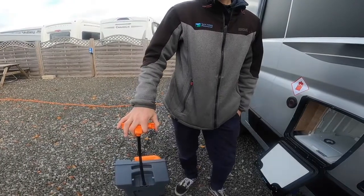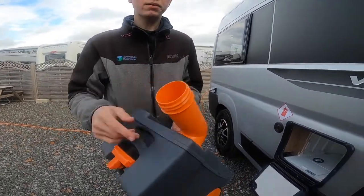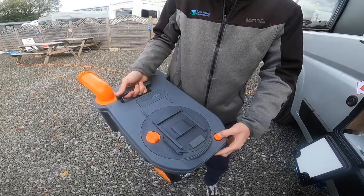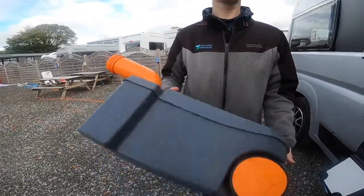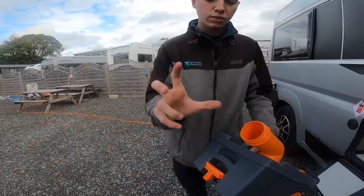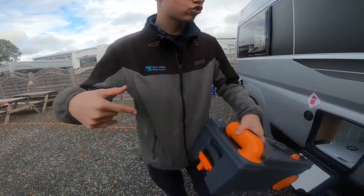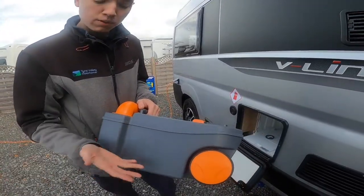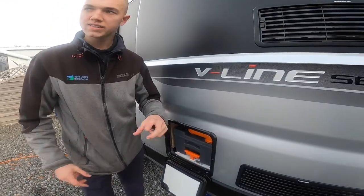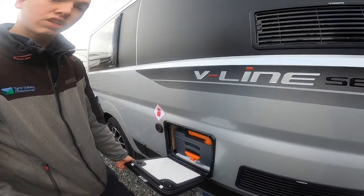You've got a handle to drag it to the waste disposal point, which is normally behind or beside your toilet block. Remove the cap, press the button which allows a bit of air in for consistent flow and stops it glugging, then tip it out. There's normally a tap there — put some water in and give it a final rinse. Using the grey cap, it takes 120ml of liquid — either the blue or green — one cap into there and it's good to go back into the motorhome. If using the tablet form, you can either put a pint of water in now or push it in empty. Open the blade, flush a pint of water down followed by a tablet in the cellophane sachet, and then the cassette's good to use until it needs changing again.